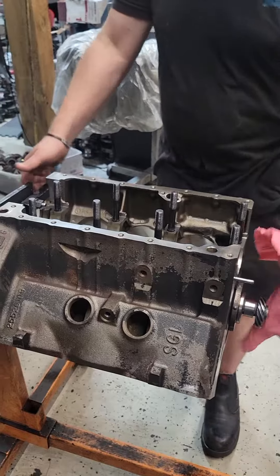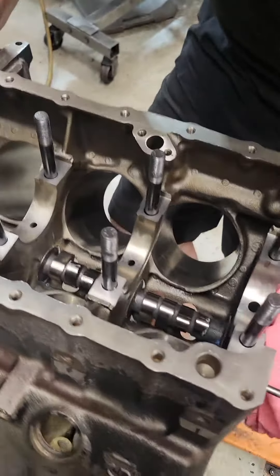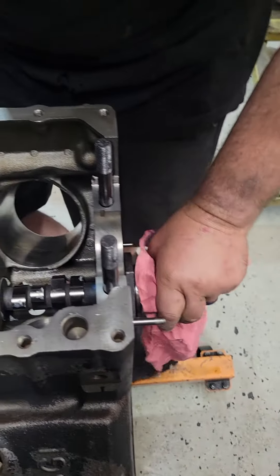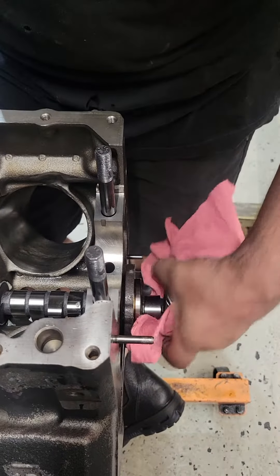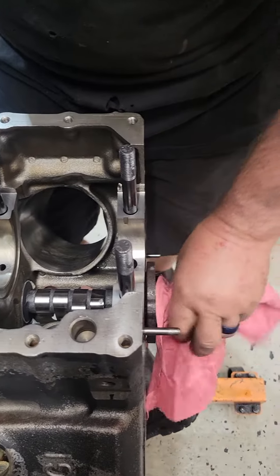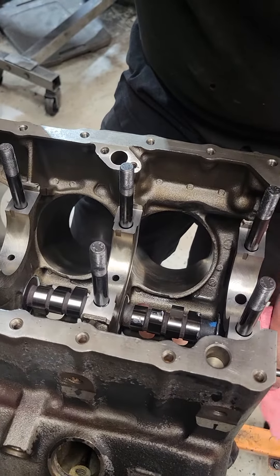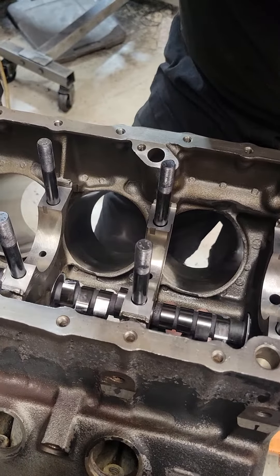But we're going to check it with the lifters in there first. Also while we're here, you can see I'm spinning the cam — the video is not going to pick it up, but I can feel a little burr right there where it's probably rubbing on the front of the block. So I'm going to pull the cam back out, get my little whiz wheel out, and file that little burr off nice and smooth, and that's going to take care of that.